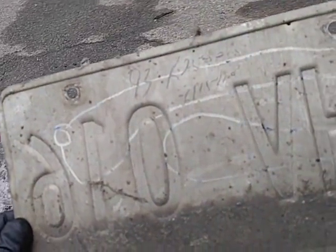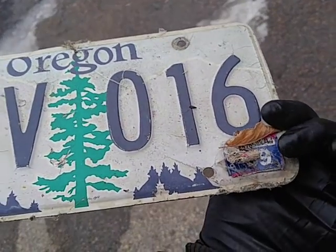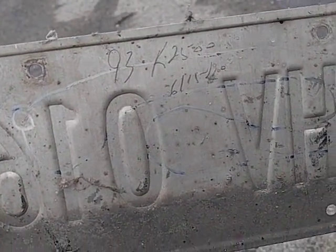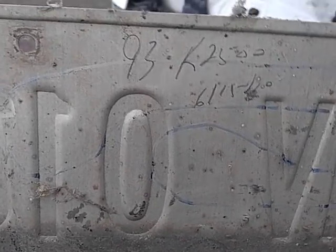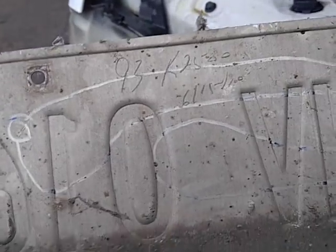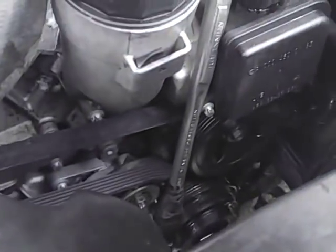I better make a diagram. I'll have Miss Hip Chick take a photograph of it. I went and made an image — I took the license plate from my '93 turbo turtle from Oregon. So here's the diagram: the alternator all the way across the top, wraps around the power steering, then around the air conditioner, all the way across the bottom, wraps around the crankshaft, and goes all the way back, wraps around the idler I just replaced, and goes all the way back across the top of the water pump and back to the start.